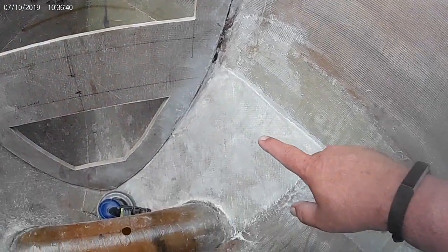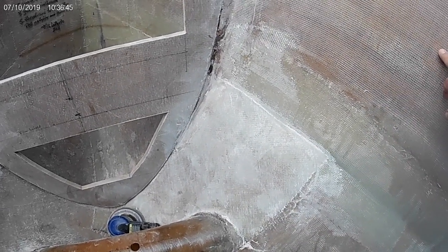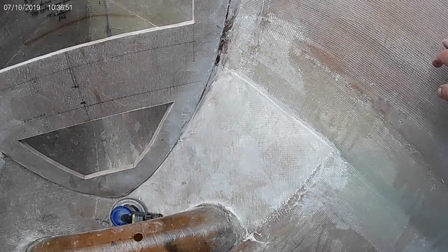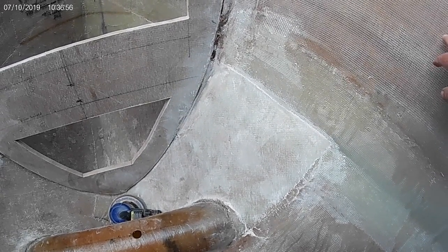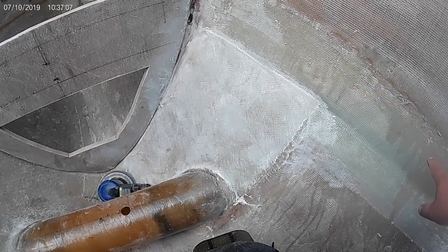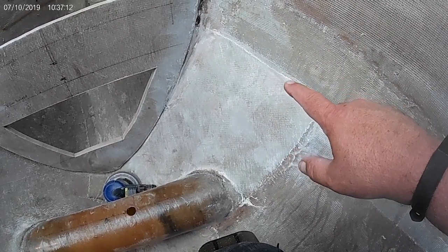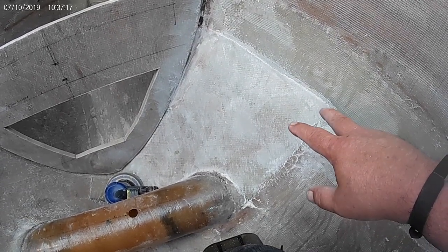Just reminded me when I was sanding this section, the inside of the hull has a layer of 1708 and a layer of 12 ounce 090 fabric, so you've got your reinforcing layers going in all points of the compass. Along the chine there are 2 layers of 6 ounce tape and 2 layers of the very heavy structural tape. I think it's 18 ounces per square yard.